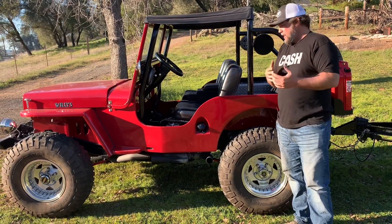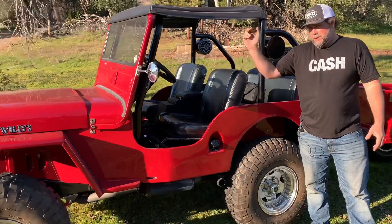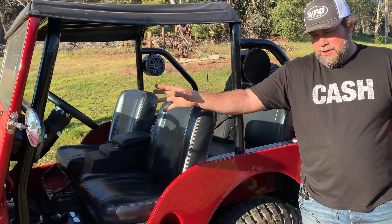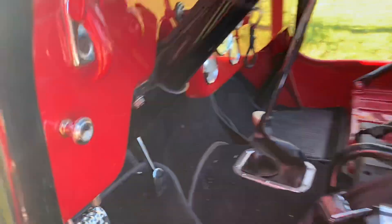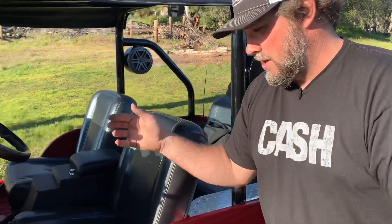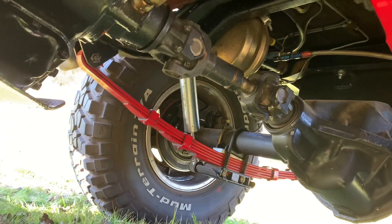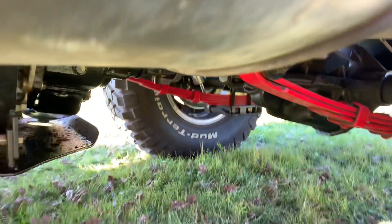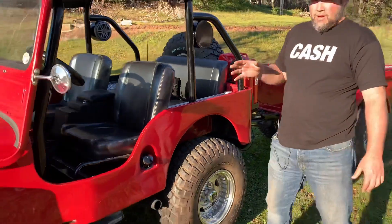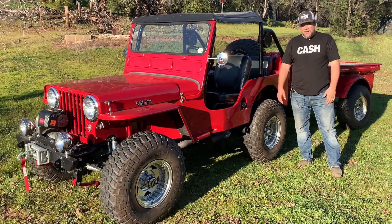With a flat fender there are a couple things to worry about: steering and brakes. Saginaw power steering, CJ Model 30 open-knuckle disc brakes in front, disc brakes in the rear, and a clean tilt column. Something different on this one — you can still see the factory brake pedal going through the floor. It's very hard to fit a swing pedal assembly in a flat fender with a big engine, so they added a vacuum booster on the back of the frame rail. The brakes are amazing — barely tap it with one foot and it stops great. Going down the freeway at 60 mph with the open-knuckle Model 30 and Saginaw steering, it's one-finger enjoyment.